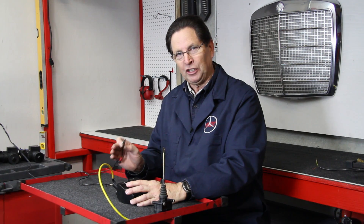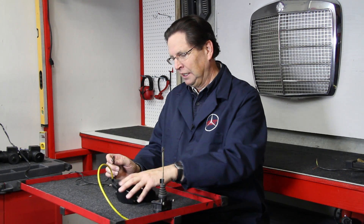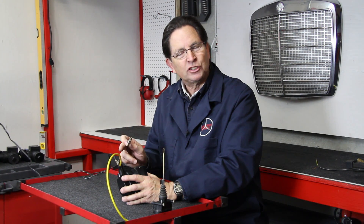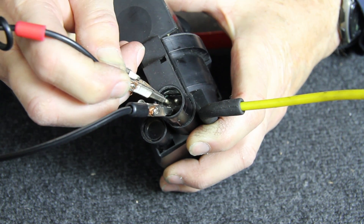In this scene I'm going to show you how to do this just using alligator clips, because a lot of you are not going to have a spare plug to test the pump with. You may have a little difficulty determining which of these pins is the ground, but go ahead and connect one and try it — if that doesn't work, move it to the next pin. It's going to be one of the three pins that's grounding the unit and it may take some experimentation. Once you've determined the ground, you can use the positive lead to alternate between the two remaining contacts to run the actuator up and down.